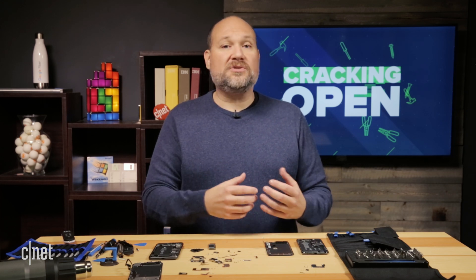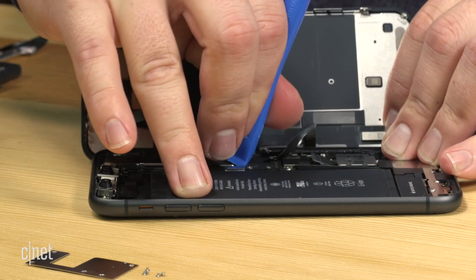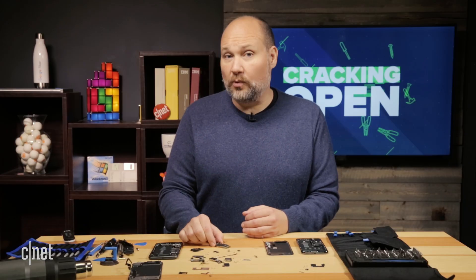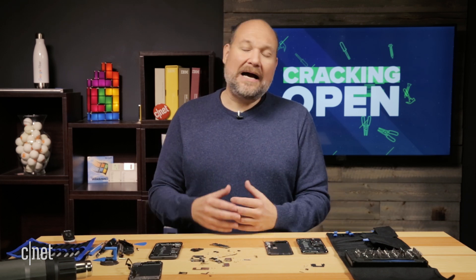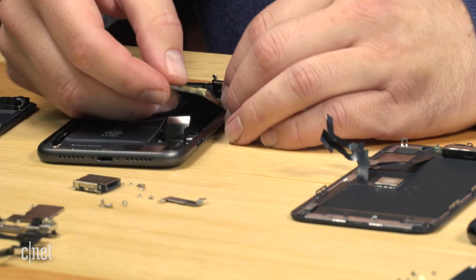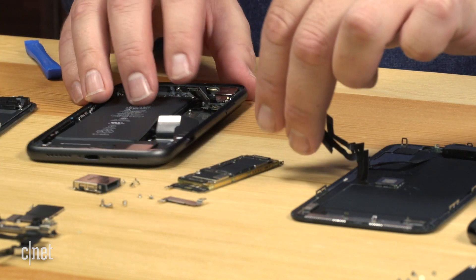For example, if you replace the screen, you're probably going to lose multi-touch, high brightness, and performance features like True Tone, Night Shift, and Haptic Touch. If you replace the flood illuminator with one that isn't specifically tied to the circuit board it came with, you'll lose access to Face ID. So while it's a pain to have to take your phone back to Apple, I honestly don't believe it's worth the trouble anymore. This took me at least 45 minutes just to disassemble, and if you damage any of the small cables, a part that was working may not be working when you're done.